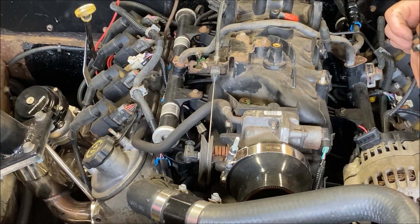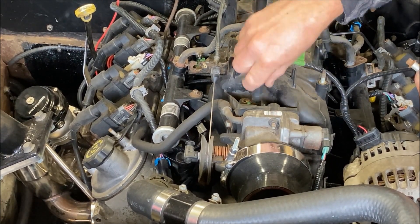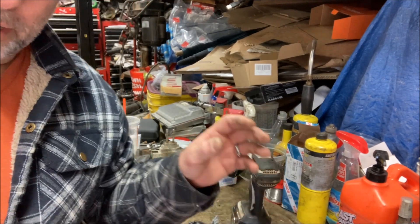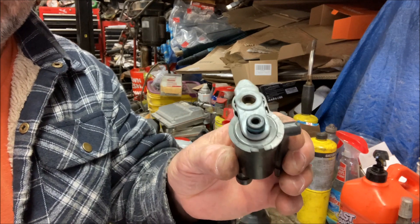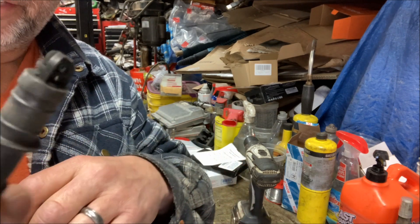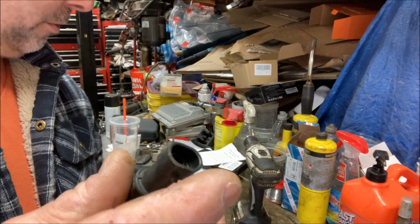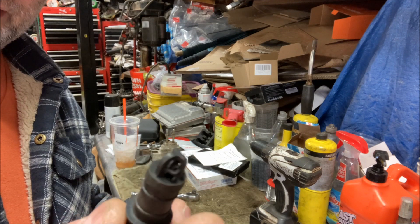What I'm wondering is how do they do it? I've seen people Dremel this out, I've seen people file this down. What would be really good is to get that O-ring off of here and put it on the IAT sensor. I realized that was out of frame - the EVAP solenoid has an O-ring seal on it, and the diameter of the IAT is a little bit bigger than this. It looks like just the end of this is kind of mushroomed, so I'm going to file down the end and try to get it to fit. This won't fit into this drill - I'm going to put this in the lathe and just put a file on it and see if I can take that down a little bit.